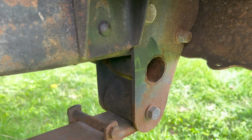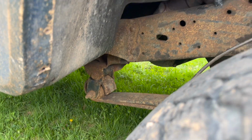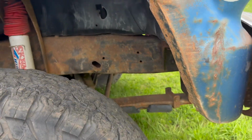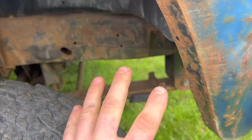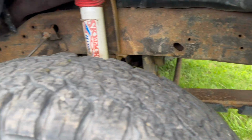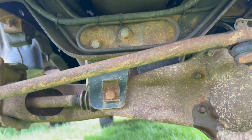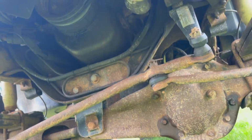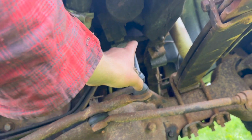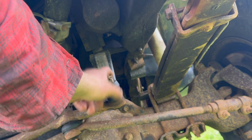Yeah, there's the Sky Manufacturing kit. It's basically a big bolt-on piece. Moves your shackle to the back. Rides decent-ish for a Dana 50. Anyway, the kit's technically made for a solid Dana 60 front end. It works okay on the Dana 50. We made our own kind of lift kit there. We got a James Duff, I think it's Duff Tough or whatever, drop pivot bracket, they're 2.5-inch, and then we have a 2.5-inch drop pitman arm as well. I think that's also Duff Tough.